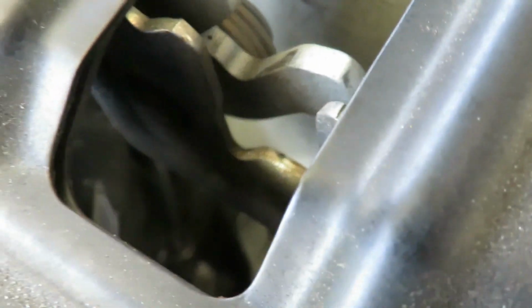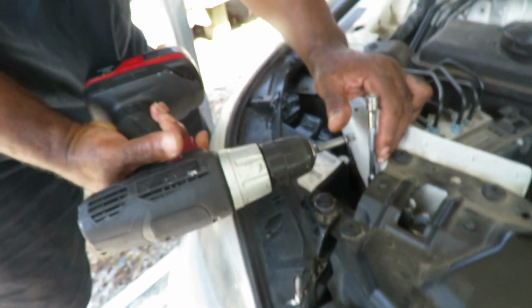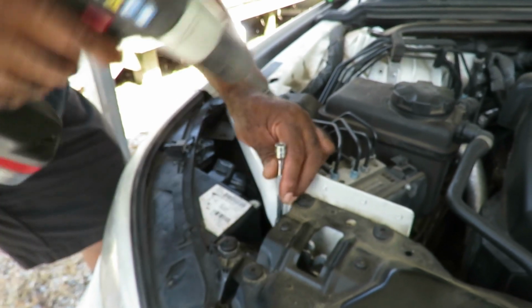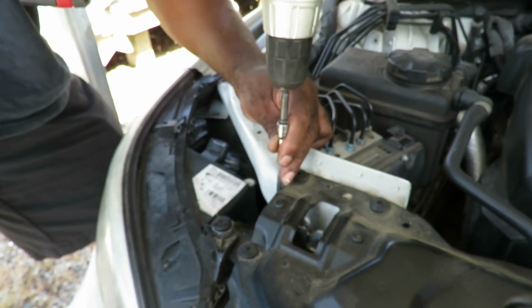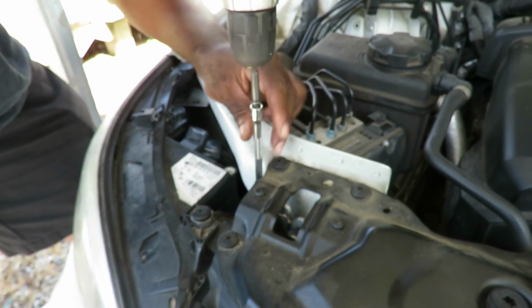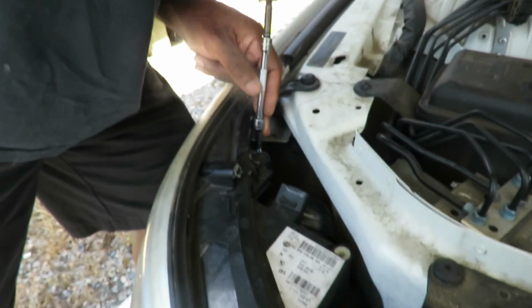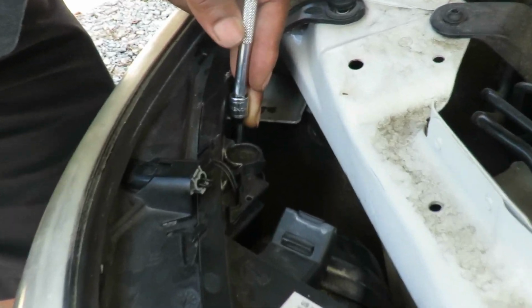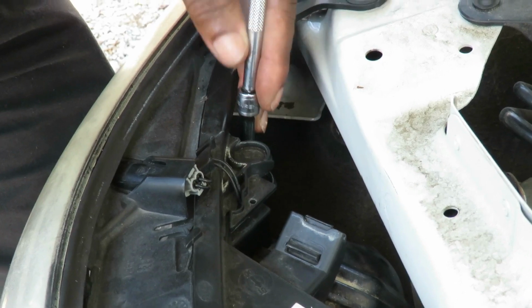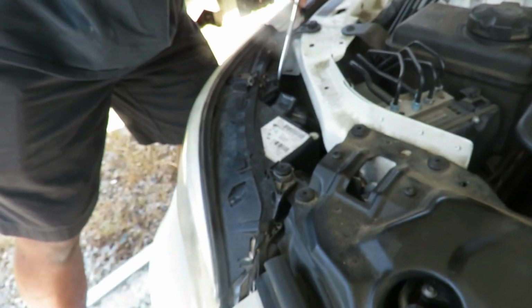and what we're going to do here is get our cordless drill with a 1/4-inch drive extension for sockets and all. And that's all we're going to do is loosen that bolt up. That's it. Just loosen the bolt up. Take it up, go over here to the next one. Loosen it up. Do not take the bolt out. Then you get a problem with getting stuck up there. All right, the next thing we're gonna do here